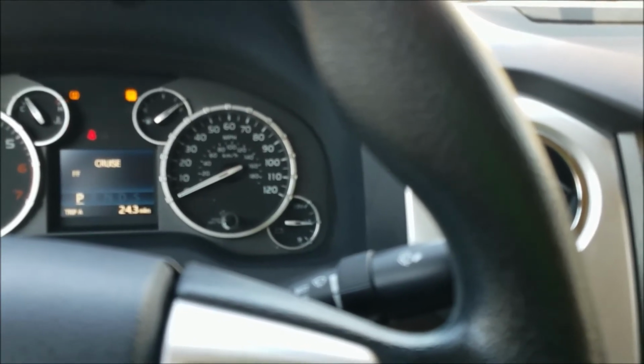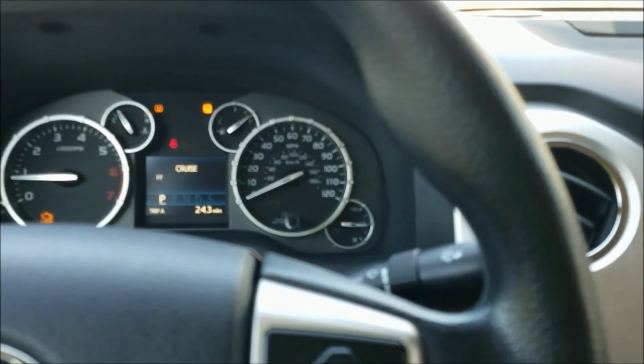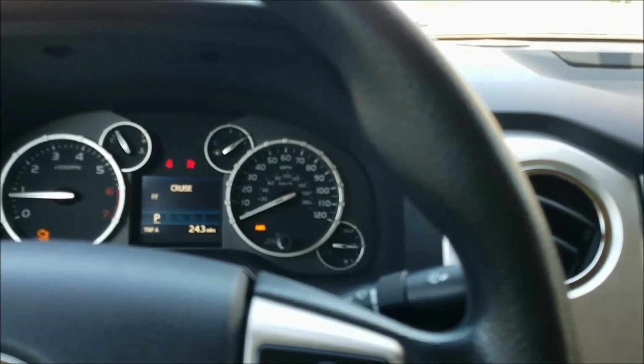If the light comes on and you wait too long and it starts flashing, then it's supposedly overfull, or the temperature is too high, I'm sorry. So then doing a level check, you would have to wait and start over again after letting it cool off, which could take several hours. So I'll check back. One other thing they say to do is you can pull the plug while it's warming up, and as it warms to the correct temperature, it will start trickling out, not dripping, trickling.